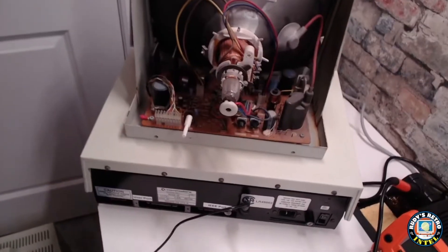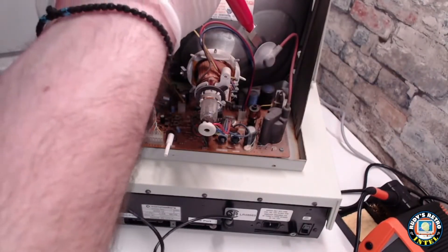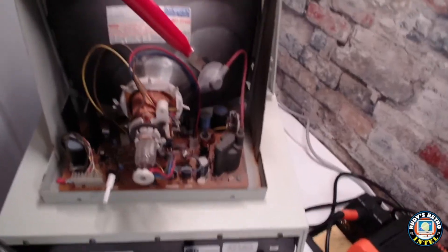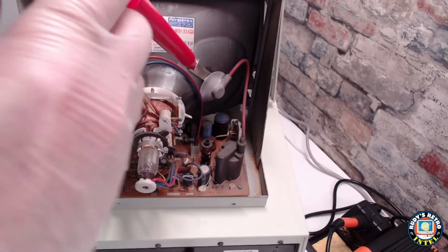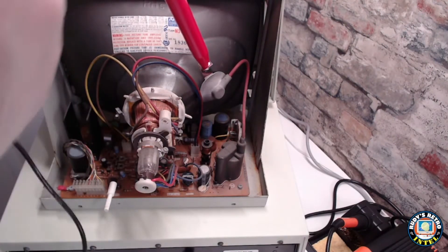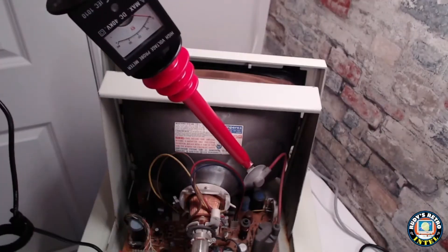We place the probe inside the connection on the monitor until we hit the metal piece. The metal piece inside is like a clip and that will discharge the monitor. The trick is getting it under that little rubber suction cup component. Once it's inside you can feel around and feel the metal piece. If the monitor has a charge you'll get a spark, but the meter is showing zero so there's no voltage — it's safe to remove.